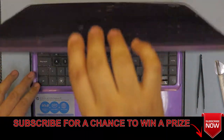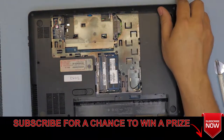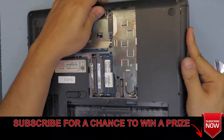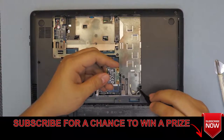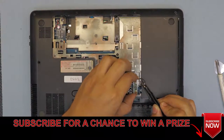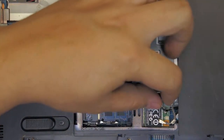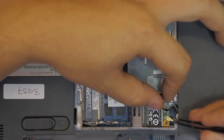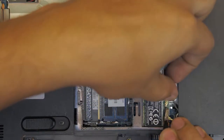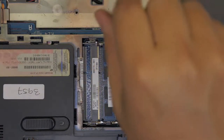That's all about it — now close the laptop lid and flip it over. Go ahead and push the CD-ROM/DVD-ROM in all the way. Grab your Wi-Fi card, at a 45-degree angle just push it down using your tweezers. Grab the cable, put it on top, and with another finger push it down the same way. Now put one screw right there — that should be a very small screw.